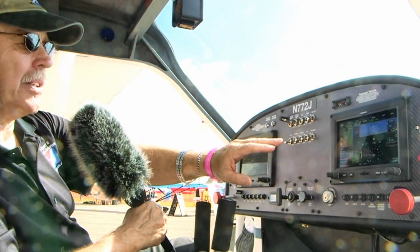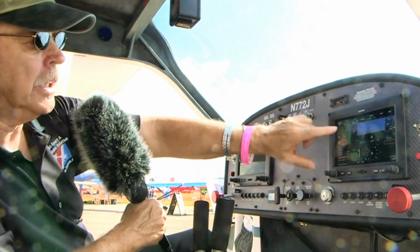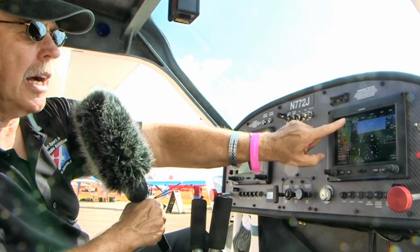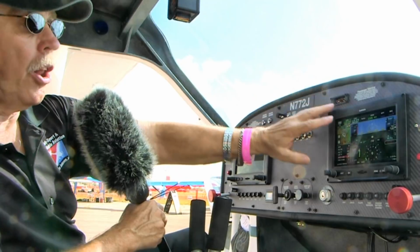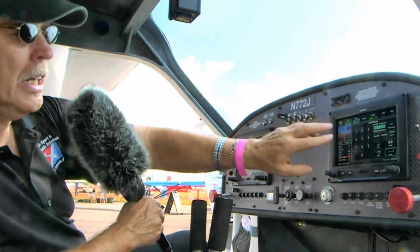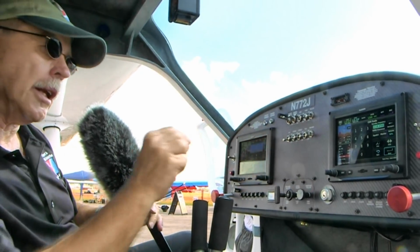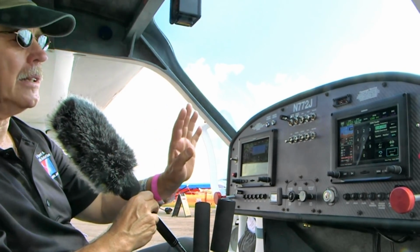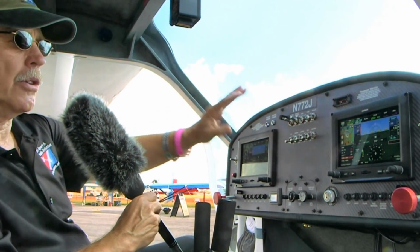One more thing I want to show you about this touch screen that's nice because, okay, where do you adjust the radio here? It's got a radio, but where do you adjust it? Well, you see the frequencies up here, COM and standby. Of course, if I touch COM, they'll reverse. So that's that flip-flop switch like some others have, but that's all they do. So now, as I was properly instructed, if you touch on standby, there we go. Now I can adjust it, and look how easy that is to adjust versus twiddling the big knob and then the little knob, and just try and do all that sometime when you're on an IFR approach. Not that you might do that in this airplane, but anyway, this makes it a lot easier. All your controls are right there, and then another tap, and that goes away, and it's back to where you were.